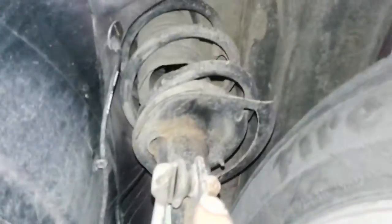Your outer CV on the right is intact. Your inner CV is a little hard to see — a bit covered in grease, but it's not ripped that I can see. Your outer tie rod on the right is here and I'm going to check that in a moment. Your strut is good and dry. Your tires, again about the same — about 30,000 kilometres left on your front right. Your rotors are not new but clean, and again about 30,000 kilometres on the front brakes.